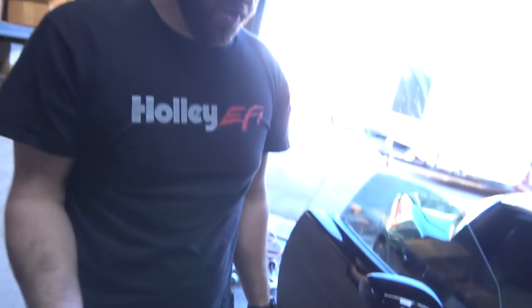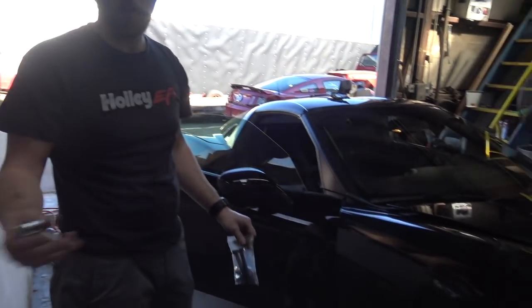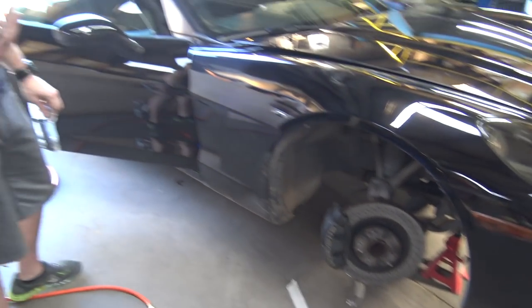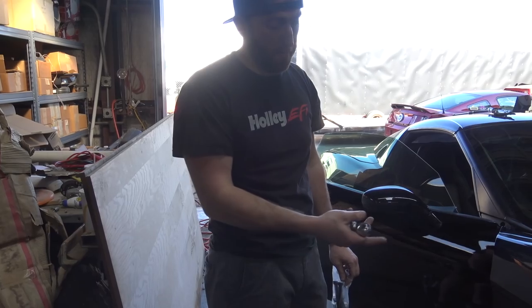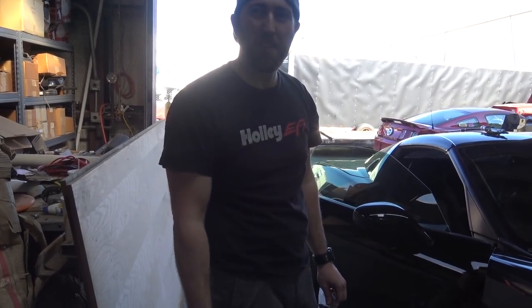And we've got multiple stages on how this is going to work. Lower control arms have already been done, and I think we're 60 plus degrees of steering angle with those. That's crazy. And you said you're going to get close to like 53 with this? That's what I'm thinking, between 50 and 53. I achieved around 52, 53, really rudimentary measurements at my house with a big brake kit, and my calipers were actually hitting the lower control arm. Oh, wow. So these are a smaller brake, so I'm hoping we'll get a little bit more out of it. That'll be sweet.